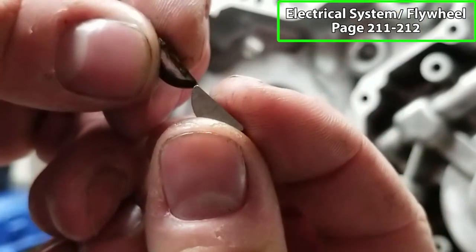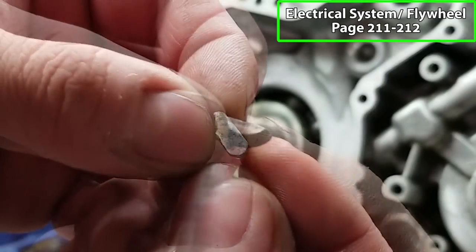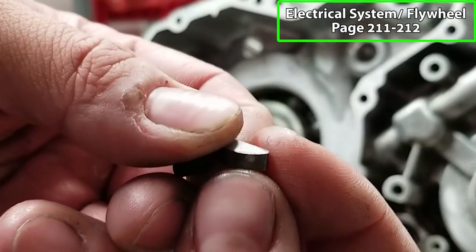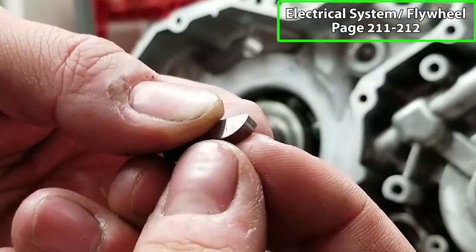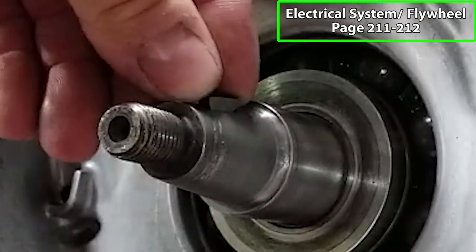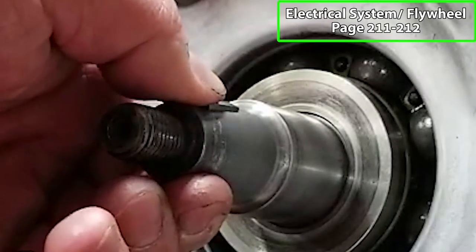The other thing I wanted to show you guys is, this is the OEM key right here. It's rounded, a little half moon. And here is the key that I'm putting in. This one is square and it's a little beefier than the OEM one. So we should have good results here. You wanna make sure your keyways are nice and clean too,